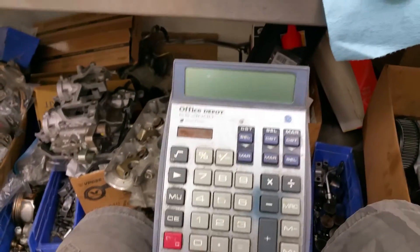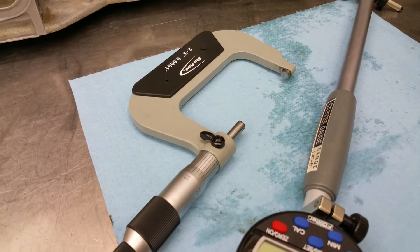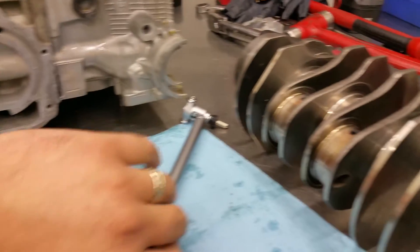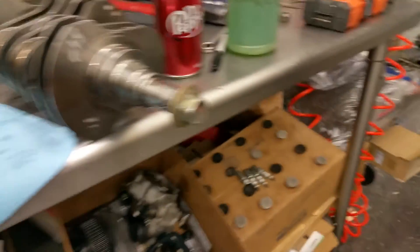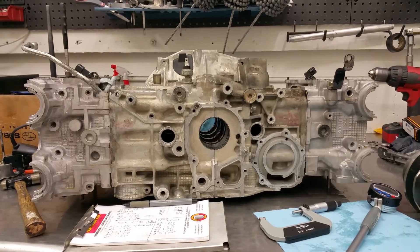So the tools required to do this job: a basic calculator, a high quality micrometer — this one here is made by Snap-on slash Bluepoint, it works extremely well — and also you're gonna need a bore gauge. This one here is digital. I spent a little bit of coin on this, but basically this is the best way to do it. You're also gonna need the crankshaft that you're gonna be using, and a whole afternoon. Steve at Horizontal Motorsports here showing you how to make Subarus better one motor at a time.